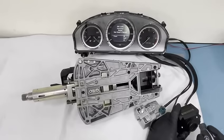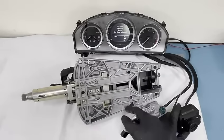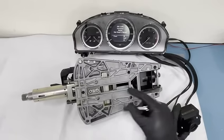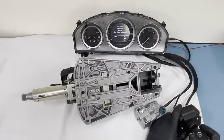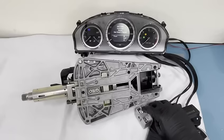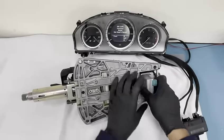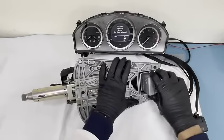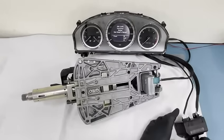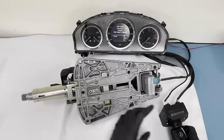Another question I get asked is how do you put this back in. If you send all this to us, we will already put this back into its steering column ready to go on the vehicle. So if I put it into the unlock position, you can see this nut here — it can go in. I'll just unplug it, push this back in, and that's all nice and locked there. We'll put the 13mm bolt back on. At the moment you can see it's freely moving.